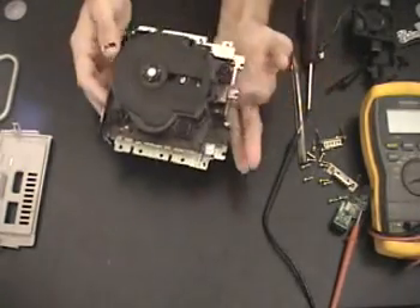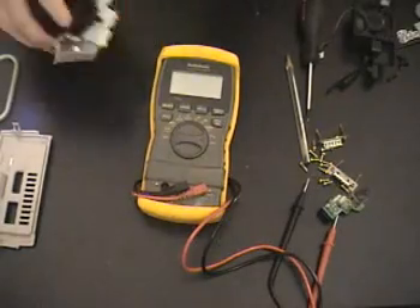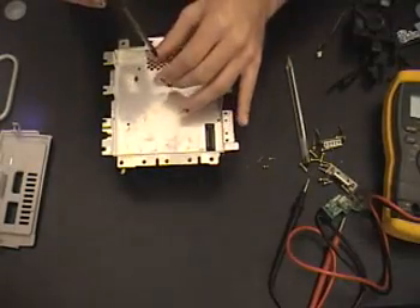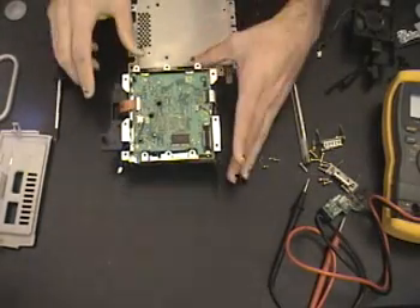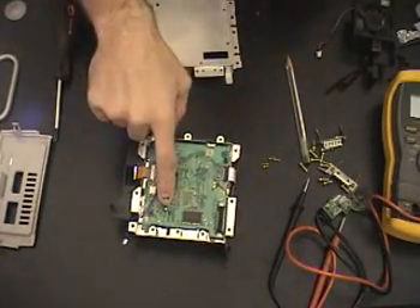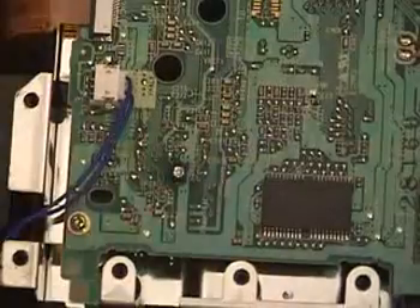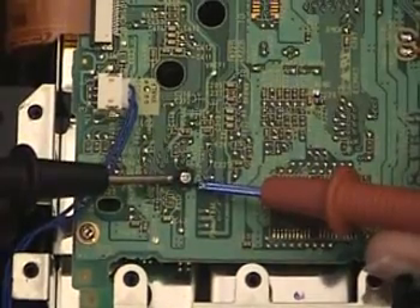There's the laser assembly. We're going to need a multimeter. There are a couple of screws around here — take them off. Then take the heat shielding and RF shielding off, and you will notice a very tiny potentiometer right here, also known as VR40. You're going to need a multimeter — an ohmmeter to be precise. Normally, this will read between 170 to 310 ohms in resistance.